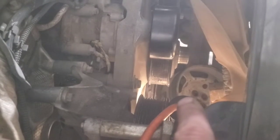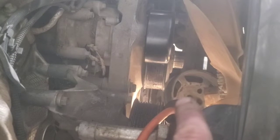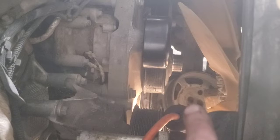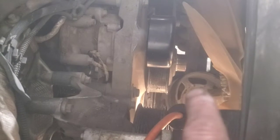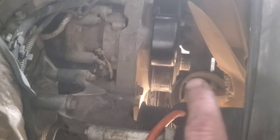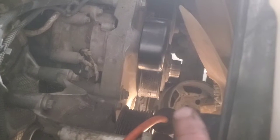You can probably get to it from up here. There are four bolts — they are 18 millimeter, 12-point. I just buzzed them out with an impact gun. You can most likely get the impact gun down here once you get the fan clutch off, which we used a removal tool to get off.